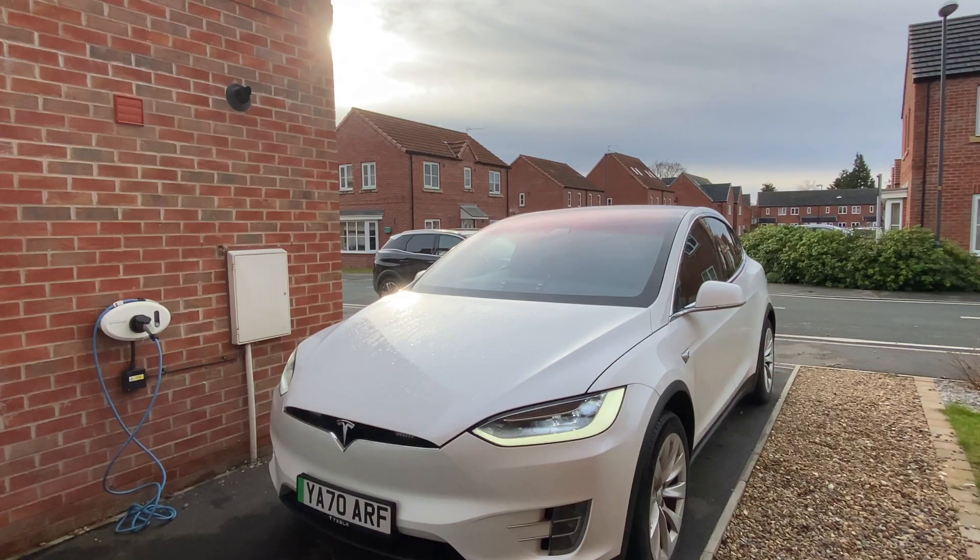This brings us to the front grill lights, which were a bit of a challenge to fit, mainly because it's not a real grill like you'd find in a traditional internal combustion engine car. In those cars the grill goes straight into the engine bay, so it's easy to thread wires through. But on the Tesla it's an air intake that goes downwards for quite a while, so there's nowhere to put the wires. What I had to do was remove the Tesla badge — there's a tiny hole behind it to thread wires through.